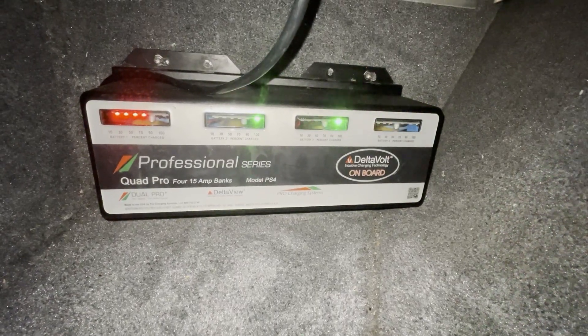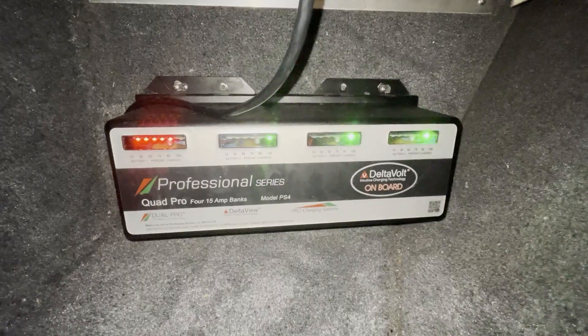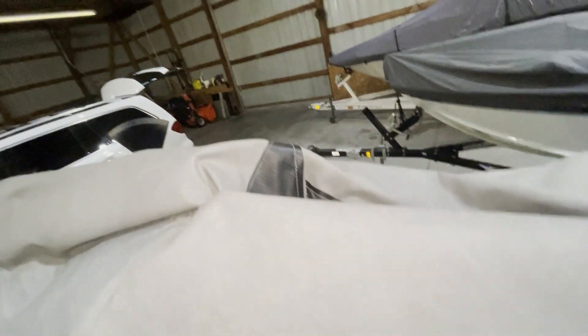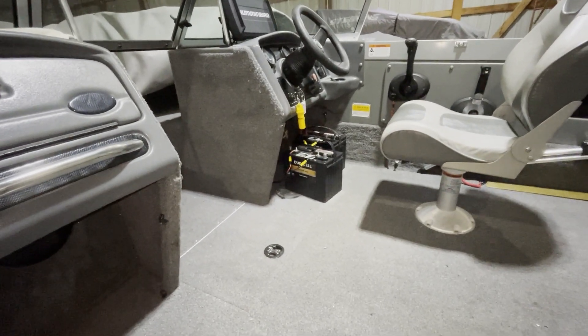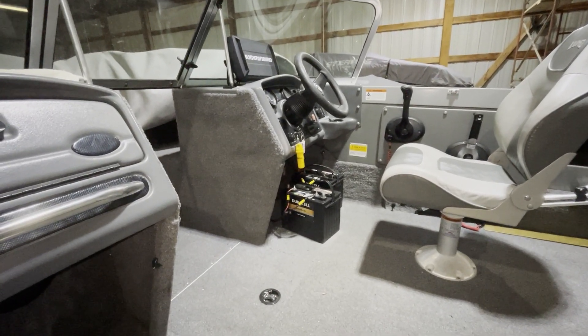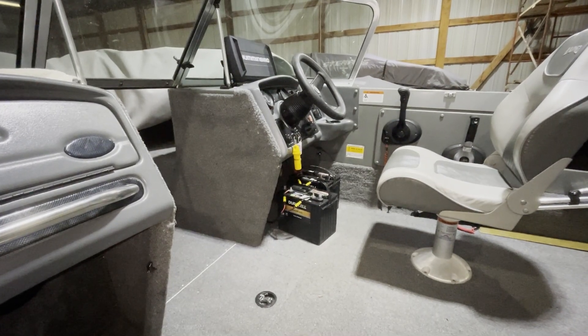Looks like that one just needs to charge for a bit. If you like how I did all this, please subscribe. It was a bit of work getting the wires through this tunnel section. Get all the electronics on one battery — you have just your motors on one battery. I'll have my two 24-volt batteries for my electric anchor and trolling motor. Then one will be for my downriggers and two Humminbird fish finders. My radio and main power will probably still go on the crank starter battery, which is the first one. My next one is battery number two, which will be my electronics. Now that they're all on a charging system, I'll be good to go.